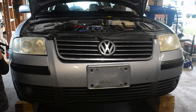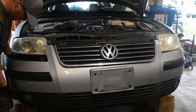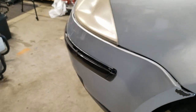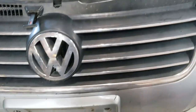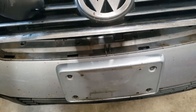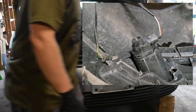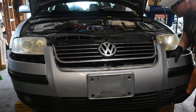The front bumper cover needs to come off to remove the headlight assembly. There are three screws to remove in the engine shield from the cover. On each side, there are two T25 Torx bolts holding the fender liner to the bumper cover, one T30 Torx in the top corner of the grill, and four T30 Torx bolts below the grill. The grill will pop up and out after the top bolts are removed. Then the cover will slide forward off of each side mount. Disconnect the connectors for the side markers and the fog lights if equipped, then the cover can be set off to the side.